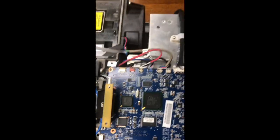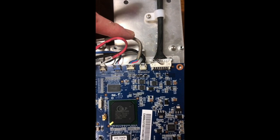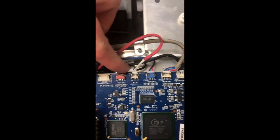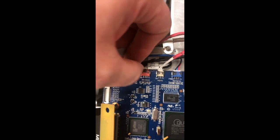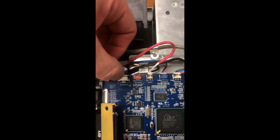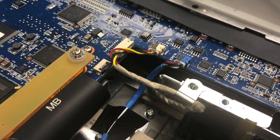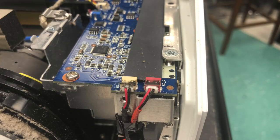I've connected all the various cables: the thicker black cable, the silver fan cable, the skinnier blue cable, the red skinny cable, and the skinny black cable. To connect the ribbon, the locking mechanism goes in and out — pull it out, then slide the ribbon in with the blue side up, and push it in to lock it in place. Once locked, make sure it feeds through the ribbon cable bracket on the left, then put those screws in. Attach the silver and blue cords, then the red and black near the lens.